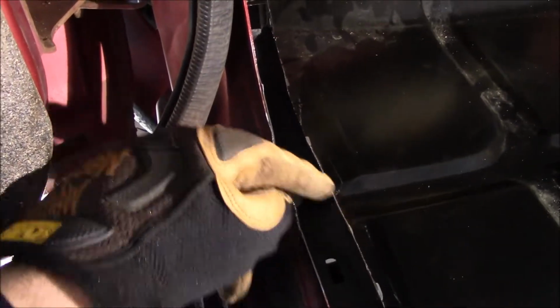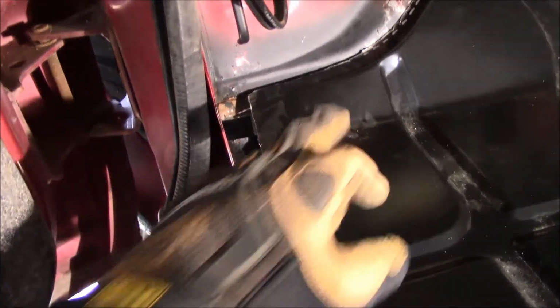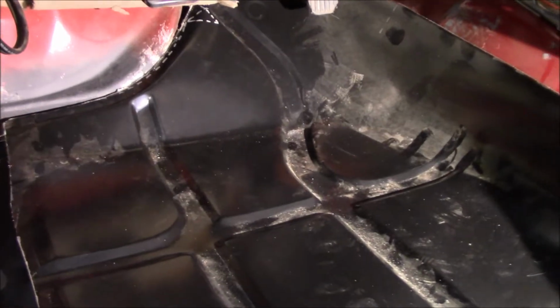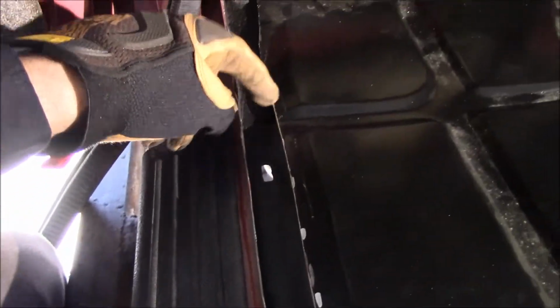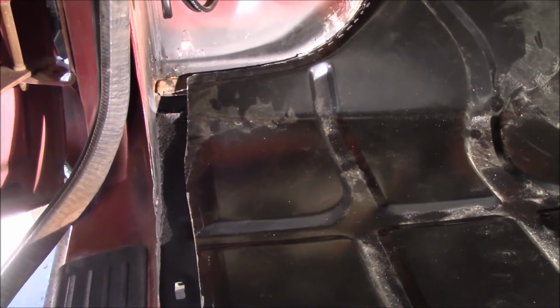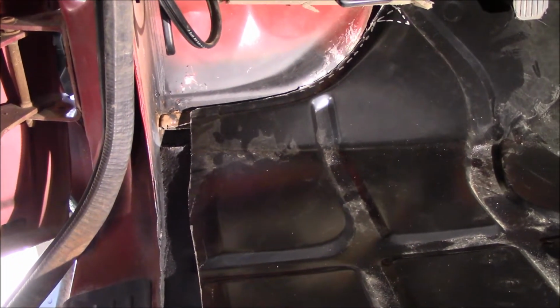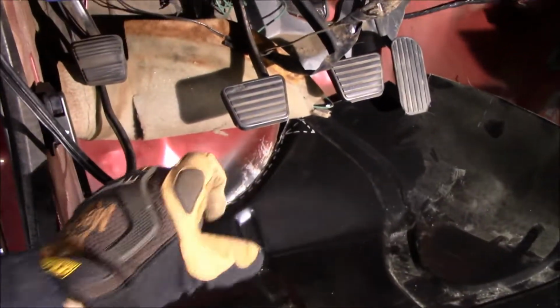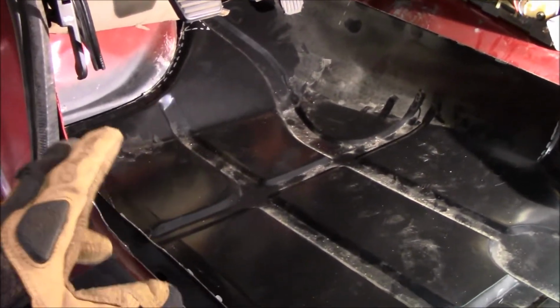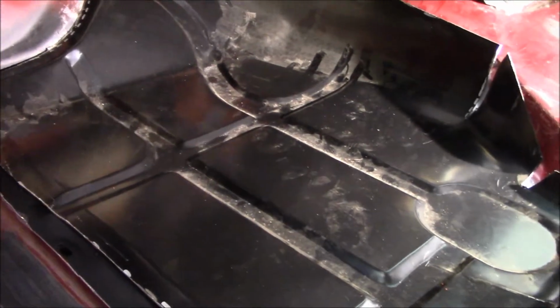Thing is, I'm like an inch back from where it should be. So the question becomes, do I cut this flange off all the way? A couple relief cuts out there, I could get it to fit, but if I cut that flange off all the way, maybe I get it closer to where I want it, because that is my inch that I'm off from where the stamping is here and here. And that is the pushback that I'm getting right there. That is honestly what I'm thinking of trying next, so I don't go past that point of return. I might just pie cut all this stuff, bend it up, and see how that fits. And again, the trick to this is cut a little at a time, and then figure out how your fitment comes, so when you've got patches like this to make, they'll be small.